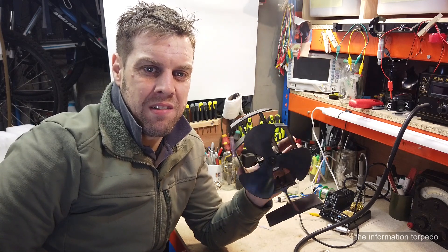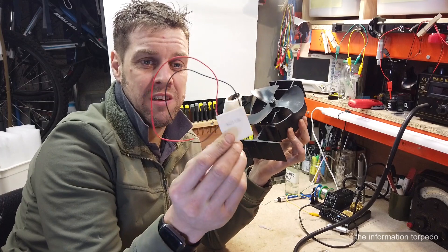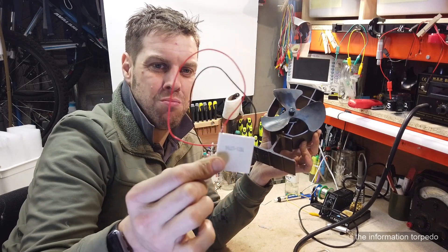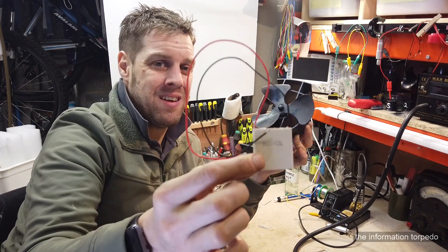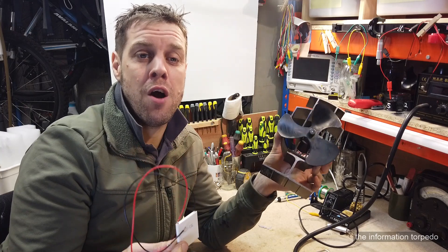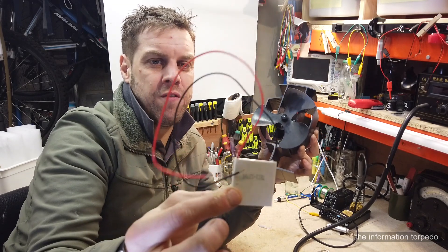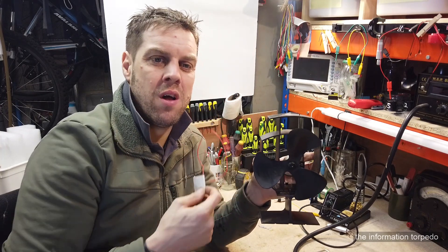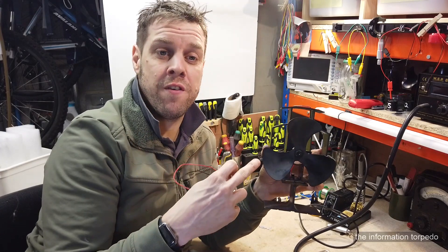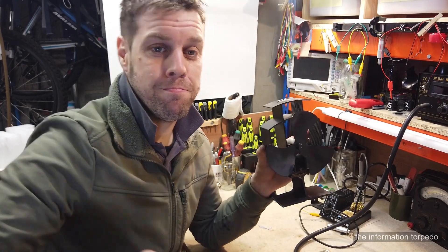I've fixed my stove fan. A cheap one that just won't work is about £30-40; a good one is £60-100. The fan, heat sinks, and motor very rarely break — it's always the peltier. All you need is a soldering iron, a replacement peltier (about £4 on eBay), and some heat transfer paste (a couple of quid). I bought three peltiers and some paste that'll last the rest of its life. Hopefully this has helped you repair something worth £50-80 for just £4. Thanks for watching — please like and subscribe, leave comments below.